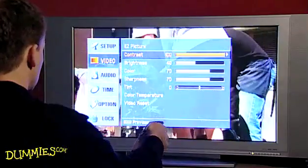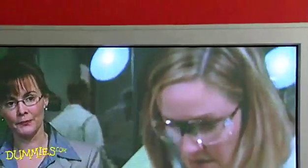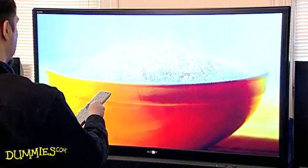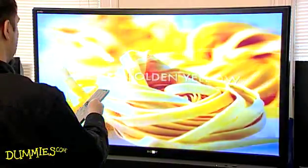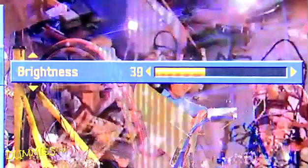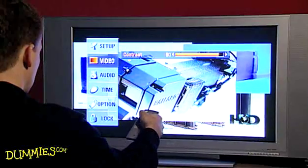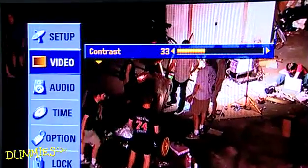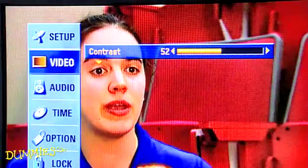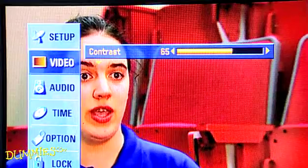You can adjust brightness, contrast, and sharpness. Factory settings on TVs are almost always tweaked to maximum brightness and contrast so that the TV pictures will pop on the store floor compared to other models. So to begin, you want to turn down the brightness and contrast until they're about one-third to one-half their standard intensity all across your screen. First, adjust the contrast or white level. If your white level is too high, the white areas of your picture bleed into the darker areas. If your white level is too low, the whites don't look truly white.